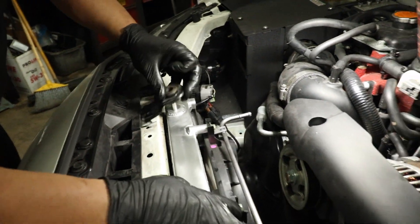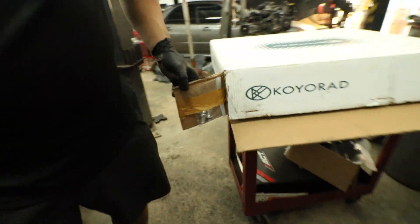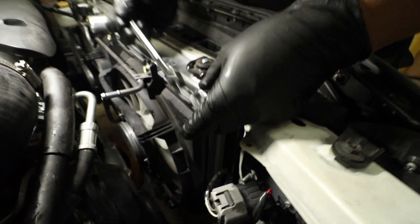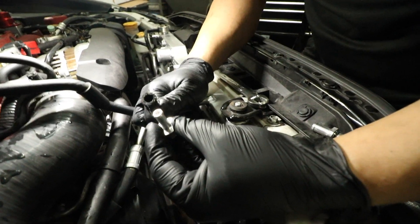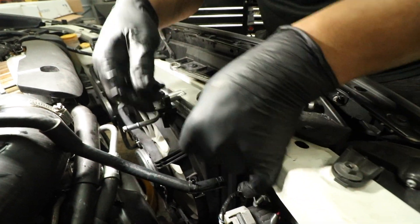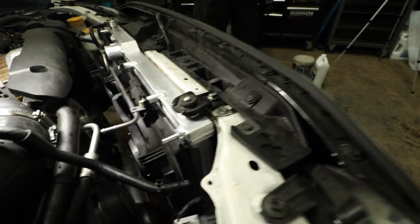Put the top brackets back on to hold it in place. Koyo adds nipples — there's a size for the older model Subarus and the newer ones. We're going to use a 17 millimeter to loosen that up. We're going to use the smaller of the two nipples — check that it fits in the hose before you put it on. Also, it might be easier to put the nipple on the radiator before you put the fans on, because as you're tightening it you start to hit the fans, and you don't want to over-tighten — just snug.